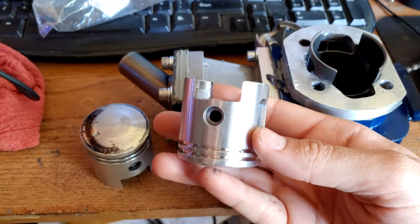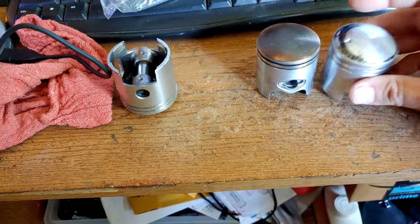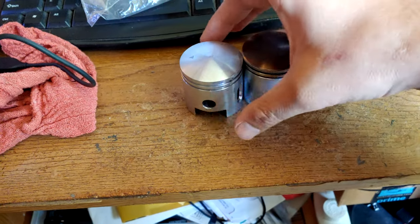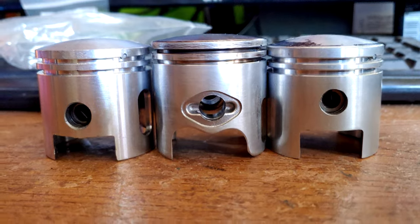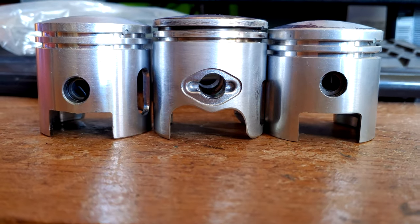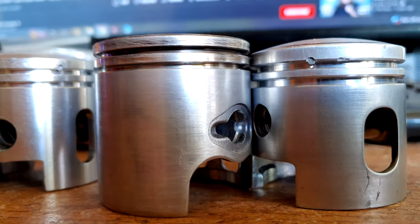One, I've got a bunch of them, and you might as well. And the two reasons that he states are, first, it's a thicker piston which should have a slower thermal expansion rate, causing less soft seizures. And two, because this piston is already designed to work with the crank in the motor, it'll be easier to balance and possibly not even necessary to do at all. So these sounded great on paper, but how about in practice?